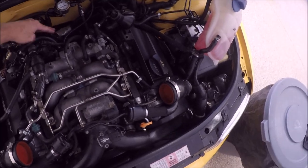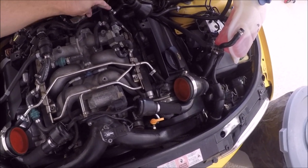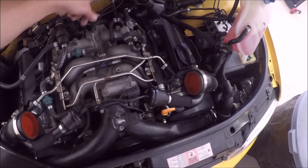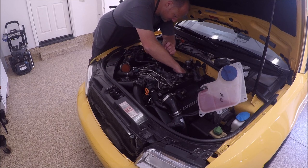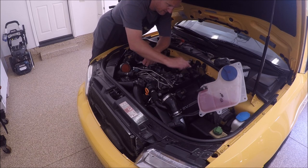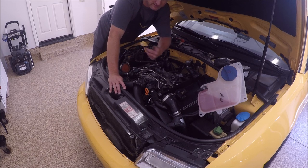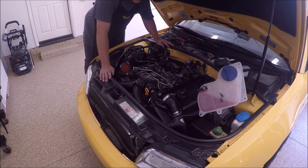My issue is I have a lot of fuel stuff in the way and that might pose a problem. This is the first time I've installed one of these so you guys are getting all the fun like I am. Here's the fuel setup - I have the Y coming off, it goes to each fuel rail, and if the catch can sits right here this is in the way. Hopefully I have enough fittings to make something come up and around. On some of your cars the spiderweb is so old it's just brittle and it's going to break apart - that's fine. You're only going to reuse this reduction valve underneath it. Through the tuner you can order a new one, or from a different company - it's all the same part.